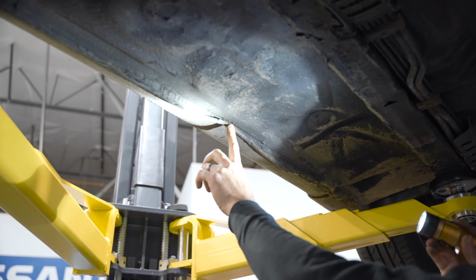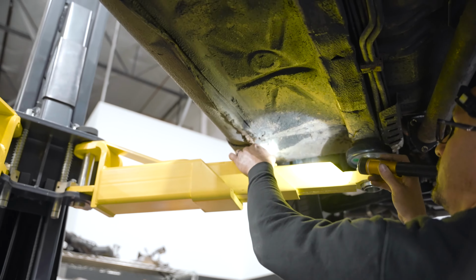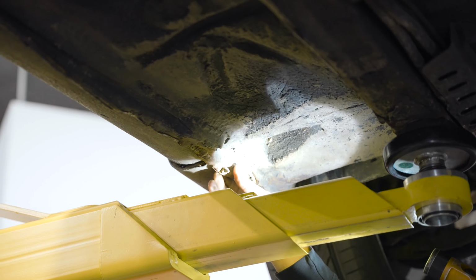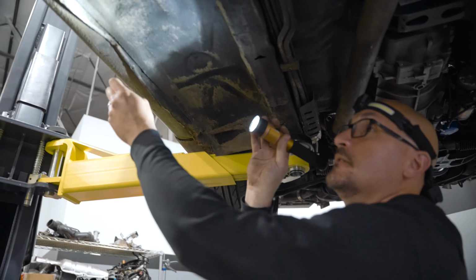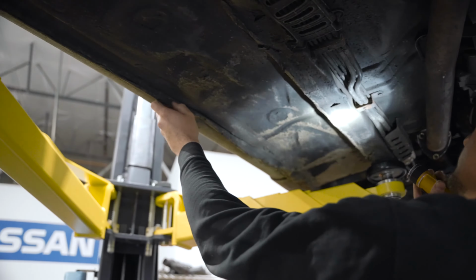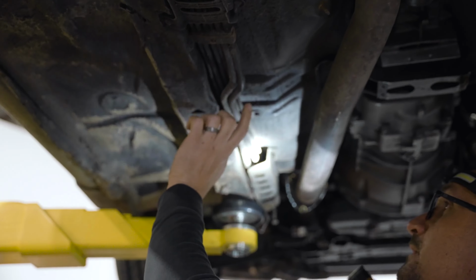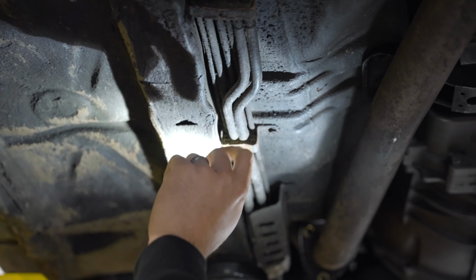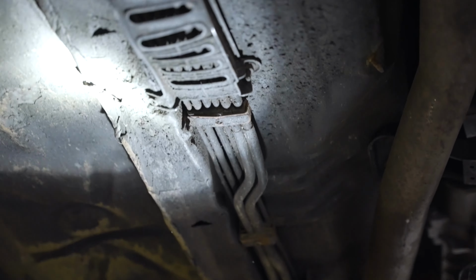Again, somebody not knowing how to jack up a Z32 did it all over here, and this goes into the fenders as well, so a fair amount of body work would be required to fix all this stuff. Clips over here. But yeah, some stuff you want to look out for, and this is where all your fuel and some of the brake lines run. And on the earlier hydraulic Z32s, the Hicas lines run through here. And this car, of course, has had the Hicas deleted.